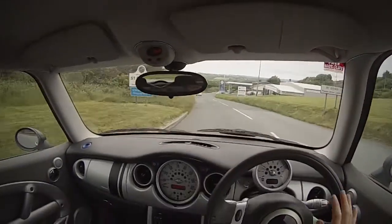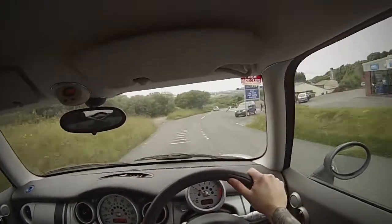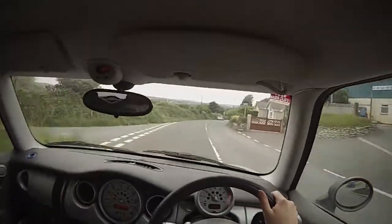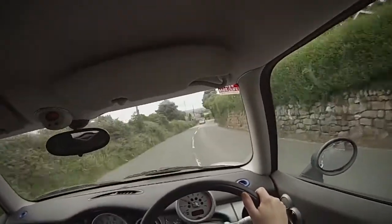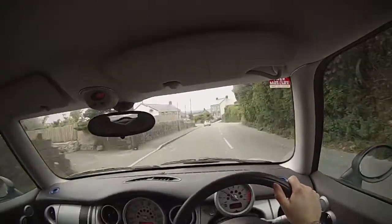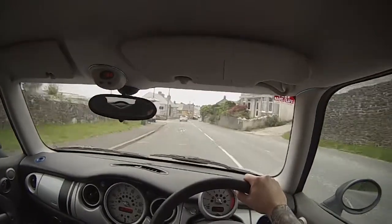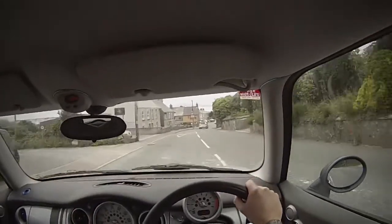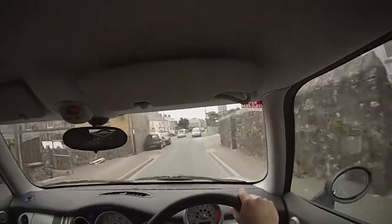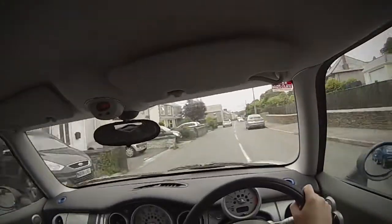Yeah, it's alright, it's feeling fine. I mean, the biggest achievement out of that clean was possibly the mass airflow sensor. It looked quite clean, to be honest, but as soon as I started spraying, the spray coming off it looked black and then went white. So obviously it needed it. I'm not surprised. I thought it would be more minging with how minging the butterfly was.